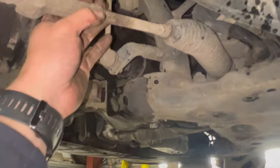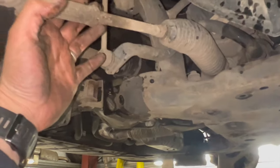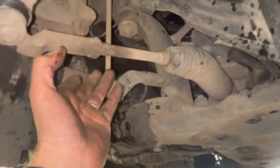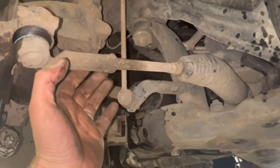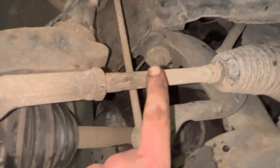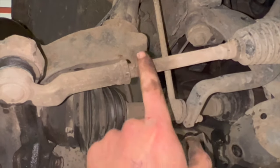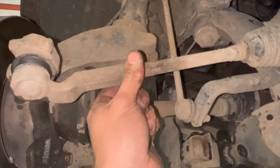Now, when you've done the suspension arm, you do really want to be tracking it up. Obviously, if you're just putting the arm on at home and you can't track it up, you don't want to be cracking your track rods off. But I'm tracking this one up here tonight, so basically clean all your threads up here on the track rod and just give them a really good scrub up and a bit of a spray with some penetrating oil.